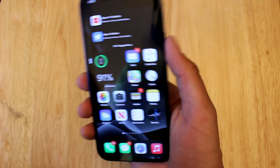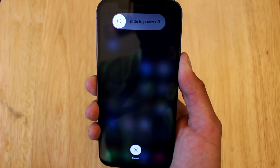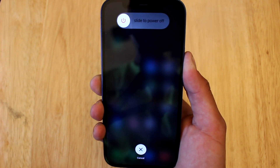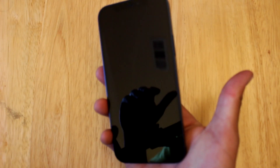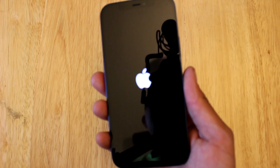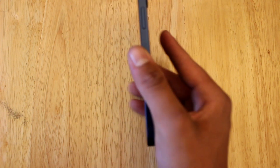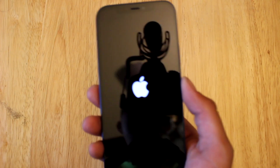So we're going to click volume up, volume down, hold the power button until the phone turns off as you'll see right now. Just give it a few seconds and it will go ahead and force restart just like so. The screen turned black. You can go ahead and let go at this point. You will get the Apple logo show up right now. Just give it a couple more seconds — just like so. There you go. That's how to force restart your iPhone 12 or any iPhone starting from the iPhone 8 and above.